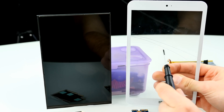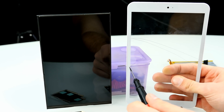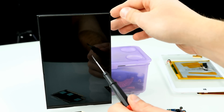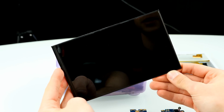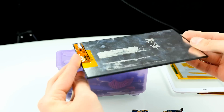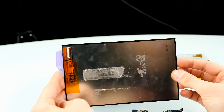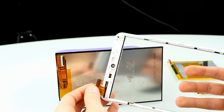The glass itself is some kind of plastic glass — not very scratch resistant — and it's really thick. There's a visible gap between the display panel and the glass. The viewing angles are quite bad, but the display itself looks good when on, completely black when off, and the resolution is actually very good. Here you can see the panel number, and the bottom PCB was just the display controller.